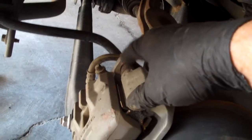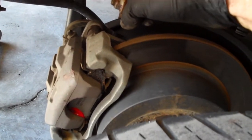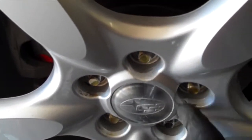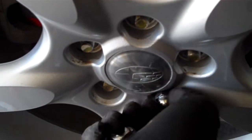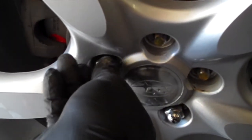When you go to put your wheel back on, this is one of the most important parts of the job. The things people screw up: they don't grease the pins, they don't make them quiet using either a lubricant or a glue, and they'll either not tighten the bolts or their wheel falls off because they don't tighten in the star pattern. If you tighten going in a circle like most people do, it'll bind down on one side and won't tighten evenly. Start on opposite sides so it goes on evenly and you'll be okay.